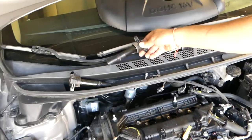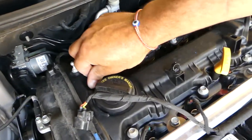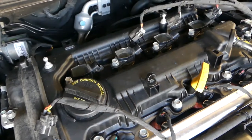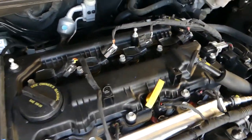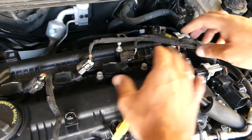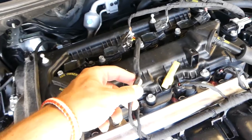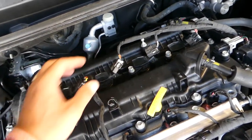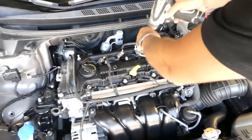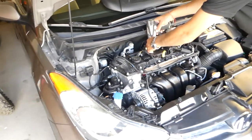Now we install the new coils. You can see right here the new coils are installed. Make sure you connect the wiring harness in the same order that it was — it's almost impossible to get wrong, except for one connector that won't reach if placed incorrectly. Otherwise the firing order will be wrong and the vehicle will not work. Thank you for watching — please subscribe and more videos to come.